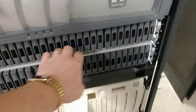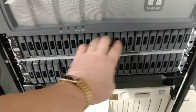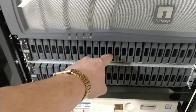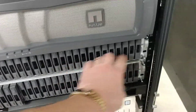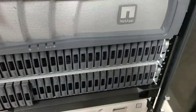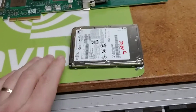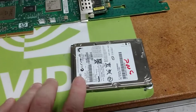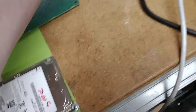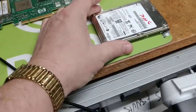So if you've got 15,000 RPM and 10,000 RPM drives, they will work very well but they're separated by size and speed. The first two channels could be 15,000 RPM SAS — say one terabyte drives — and the next two channels would be 10,000 RPM SAS. I don't recommend anything slower than 7200 RPM for a SAS bus, because the SAS bus can do SATA and SAS, but the nature of how this bus communicates is driven on the priority of the SCSI communication busing from back end to front end.